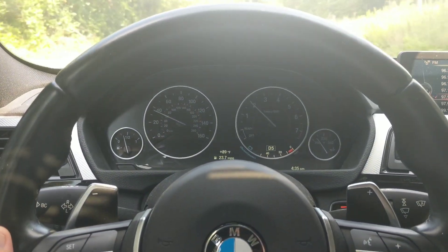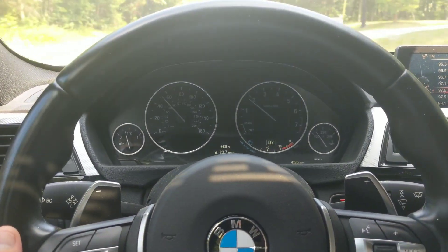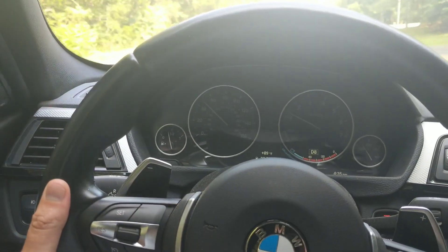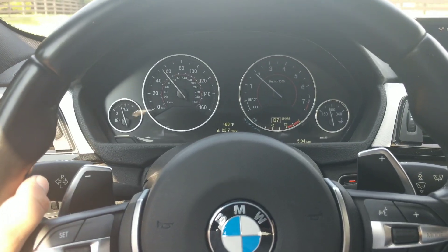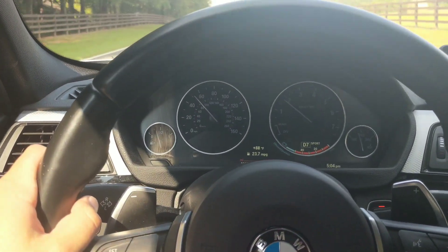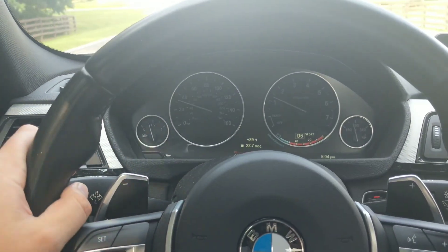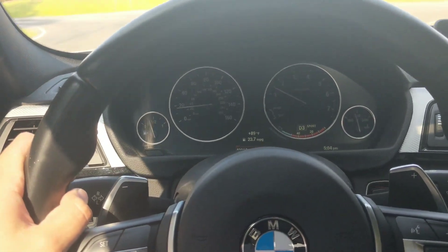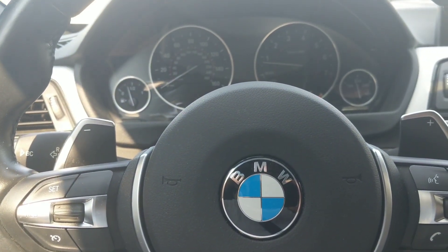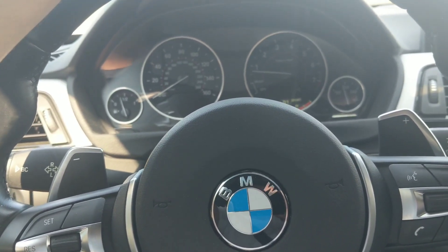It's smooth as butter kicking into that next gear. You can feel it a little bit on the upshift — it's a little more aggressive — but the downshifts are way smoother. It's downshifting at a lower RPM than it was before, which is easier on the trans. In sport mode, what I really like is the lightning-fast shifts. Coming up on a stop sign, the downshift is the least aggressive ever — it doesn't burble at all without me wanting it to. If I set my minimum burble to 1700 RPM, as it's downshifting on its own it's not even reaching that point, which means I can leave it in sport mode without being obnoxious everywhere. But if I want it to backfire and burble, I can choose to do so.